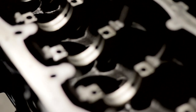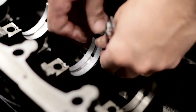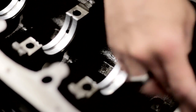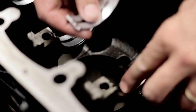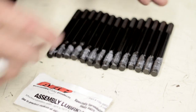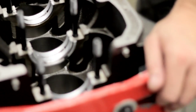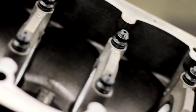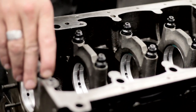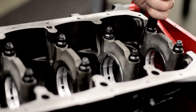This front one's a white bearing — why are you running a white bearing in the front? The timing chain up front is causing a little bit of wear on the crankshaft, so I'm tightening up the main clearance on the front main. The white bearing is about two tenths tighter than the green. I've got some ARP lube on the main line studs so I'm going to install the main line studs, set the caps, and torque these nuts down to 60 foot-pounds, then come in and bore gauge the bearing clearance.